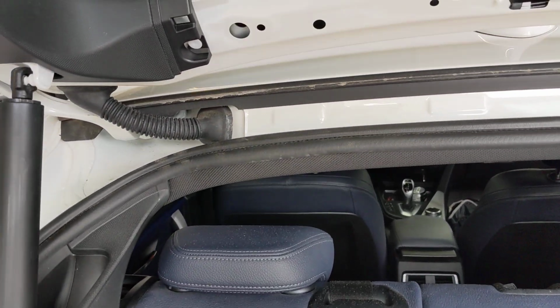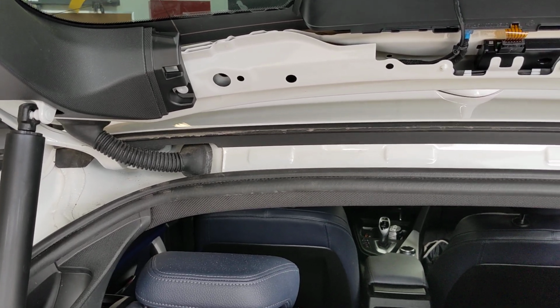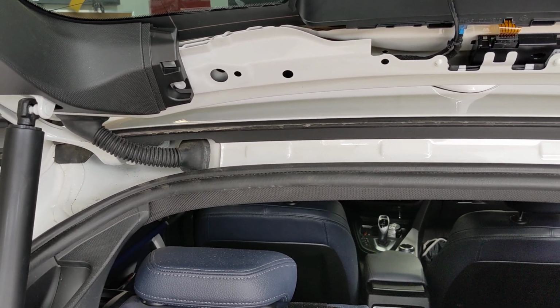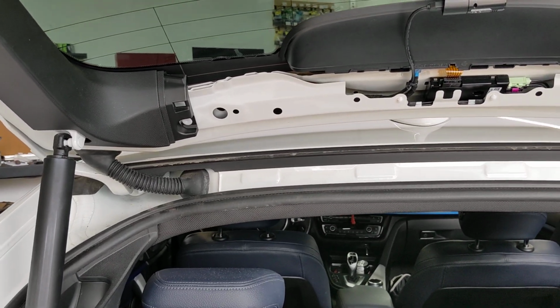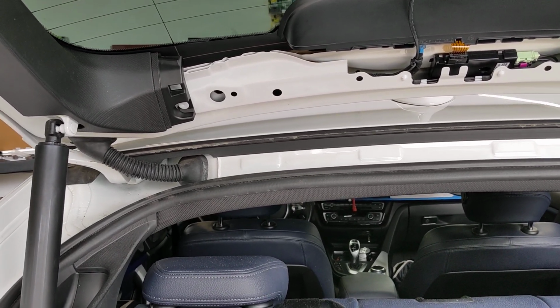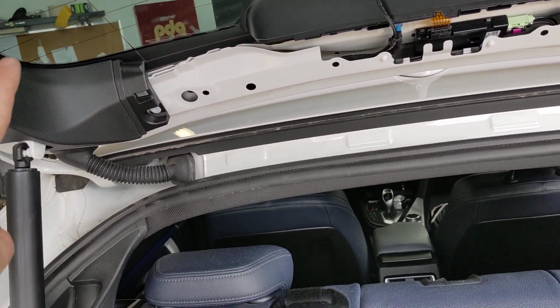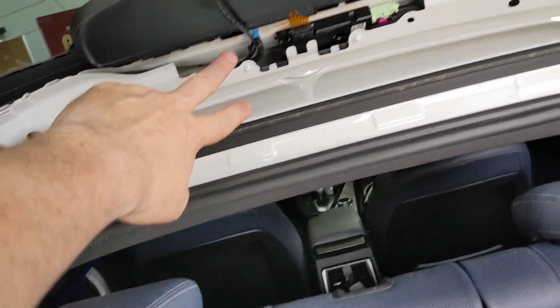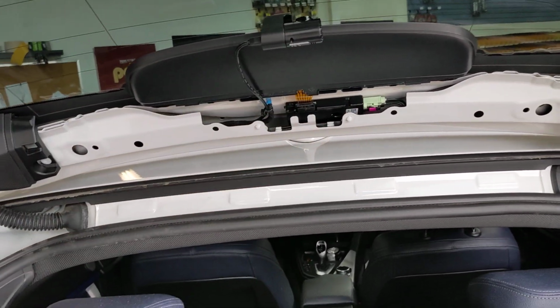Then you use electrical tape on the straight end of the cable. This particular camera has a straight-end USB cable for the rear camera and an L end. The L-shaped end goes to the front. So you tape the straight end to the zip tie, and then you fish it back through, and then you fish it underneath this metal. As you'll see, it comes out there, and then it goes up top there, and once you're done, you put the paneling back on.